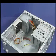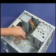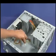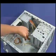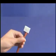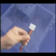An ATX 12-volt or SFX 12-volt power supply must be used in a Pentium 4 processor-based system. Both power supplies have an extra 2x2 connector to supply additional 12-volt current to the system, in addition to the standard 2x10 connector. Most ATX form factor-based motherboards with fully loaded system configurations may also require the 1x6 connector. Consult the motherboard documentation to determine power supply requirements.